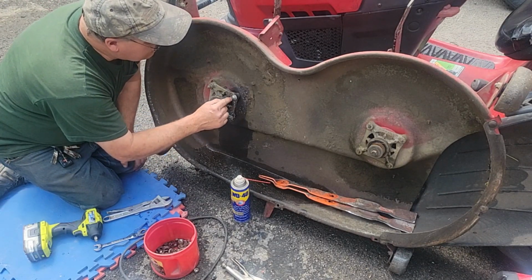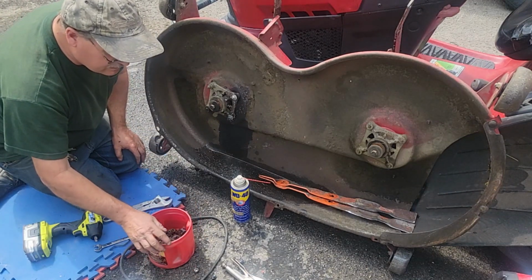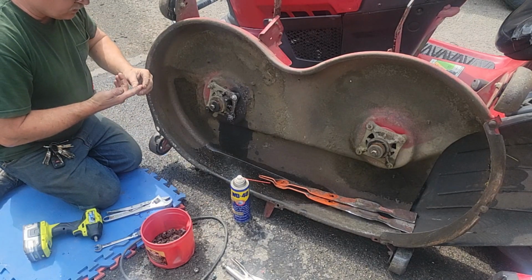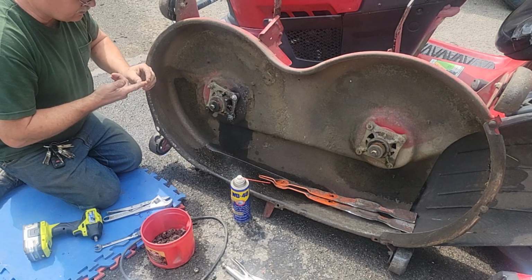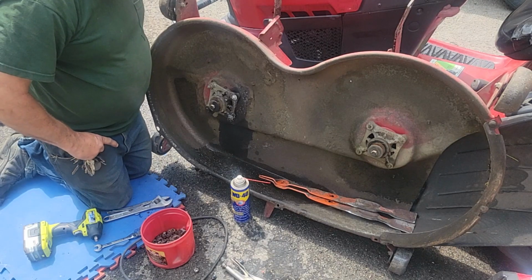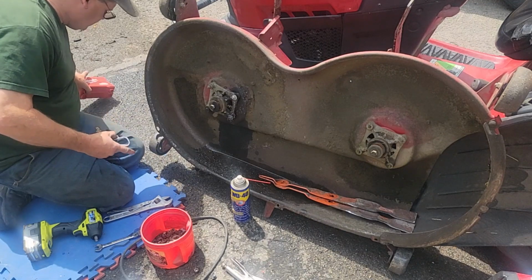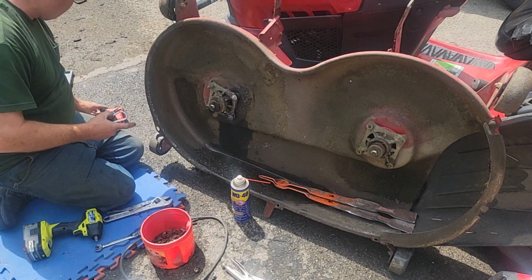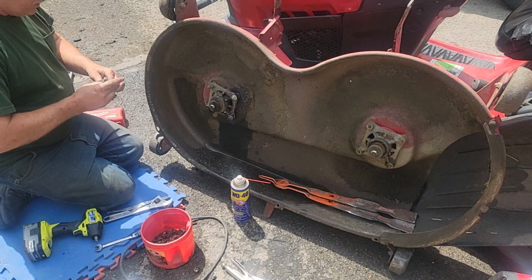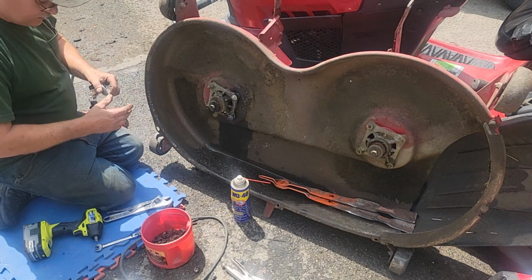The problem bolt, I welded a few nuts on there. It looks like at least 4, just like an exhaust manifold, but it didn't work. It a sliver here, metal sliver. It didn't work, so I drilled out the bolt. These Milwaukee bits are nice. They're called Shockwave titanium. I always worry about wobbling and breaking them. You do that once in a while. But there, got that guy out.